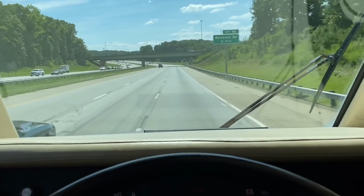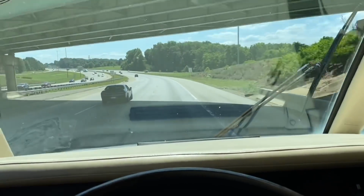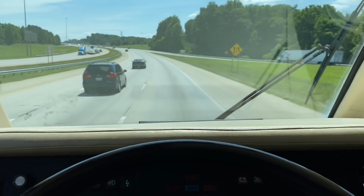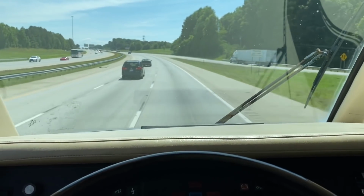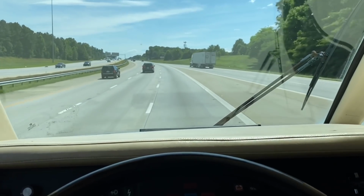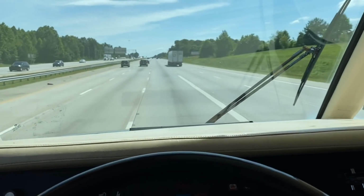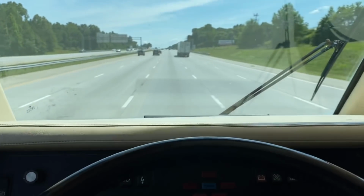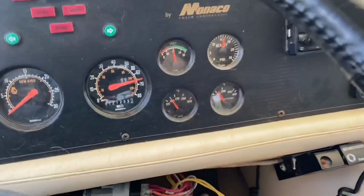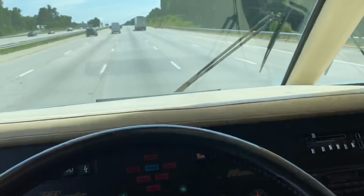So now we figured that out, but it went to the transmission and to the fuel bowl and fuel pump. Without power to both of those, you're not going to get anything working. So I clipped that wire going to both of those, hot wired it to a power source in the back, and then basically just jumped the starter over, and it cranked up. And we've been running. I did stop at a rest area just to make sure nothing was burning that I didn't know of. And if I touch those yellow wires back to over here, the switch actually works now. But there's a dead short somewhere in that yellow wire.